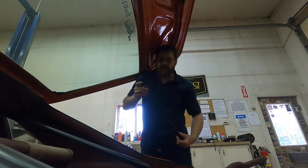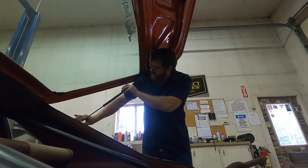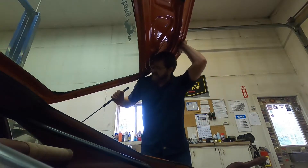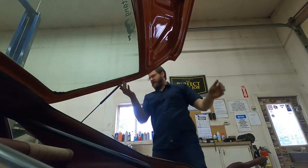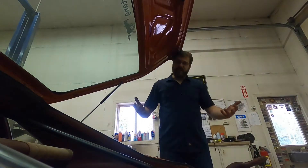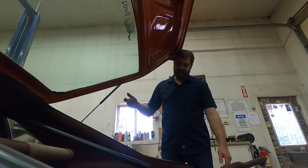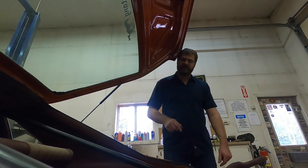Take the new one — the spring clips are already installed on the new one — so you just put it in place. It kind of snaps and clicks into place. Line this hatch up, put it in the top hole, and it clicks into place again. That strut is now replaced. That's all there is to changing one of these. They're actually very easy to do. You'll see these on hatches, hoods, and all kinds of places. Thanks for watching — hit that subscribe button and I'll see you later.